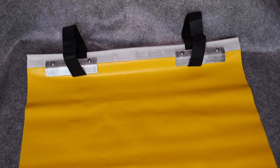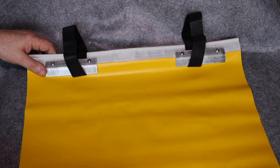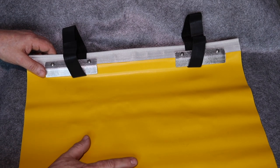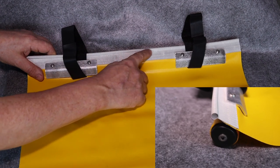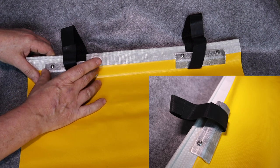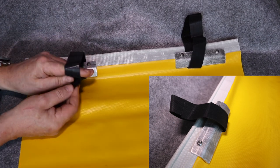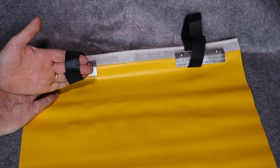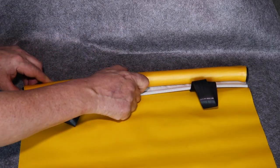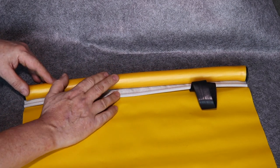Taking a close-up look at the Slip Stop: you have a section of yellow thick vinyl material to protect your caravan side from the ladder. At the top is a gray piping section that fits inside your awning rail. There are two aluminium plates securing the velcro, which fits around your ladder rung on either side. On the reverse is a section of firm rubber tubing that protects your caravan against the weight of yourself and the ladder.